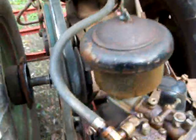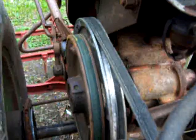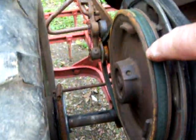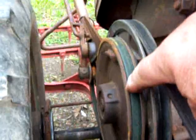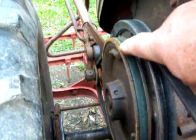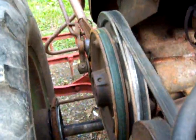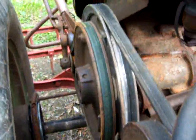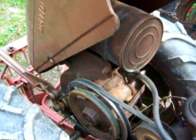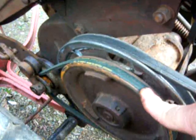When this mower is running, the main transmission belt turns counterclockwise — facing the shroud, the engine turns clockwise, transmission turns counterclockwise. However, this outer belt is the transmission belt. When you engage with the handle, there's a clutch in it which catches the gear inside and turns it in the opposite direction. That turning in the opposite direction is what gives you the reverse. The big pulley turns in one direction; the small pulley when engaged will turn the other direction.